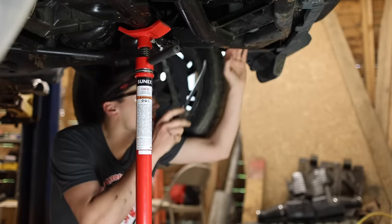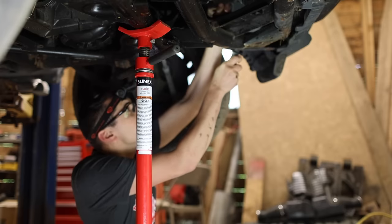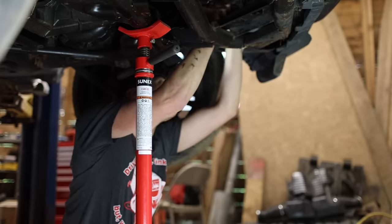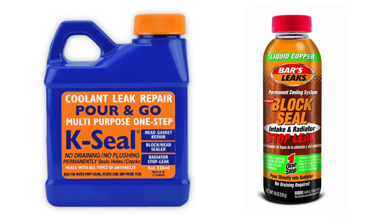Next I need to drain the radiator to remove it and a bunch of other stuff on the front to make room — and this is pretty much guaranteed to make a huge mess. Oh no, take a look at this. See all those copper flakes at the bottom? That's really bad news. I did a little research and found that there are radiator coolant stop leak products that contain copper-colored flakes like what we found in the coolant, and those products are advertised as solving head gasket issues — which really makes me wonder if that's what we're dealing with here.